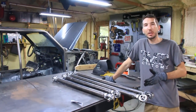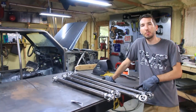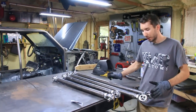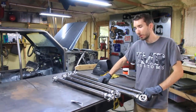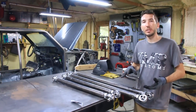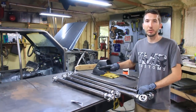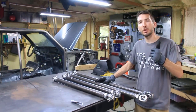Remember, if you want to make these on your own, I got these heim joints and all the materials at TMR Customs. I'm not sure if they sell link material, but you can get that at your local metal supply — this stuff is heavy so it would probably be expensive to ship. They also make aluminum links; if you did aluminum links you wouldn't have to have the bung. My question for you in the comments: would it be better to have lighter aluminum links which raise your center of gravity, or heavier steel links that lower your center of gravity? Hit the thumbs up, subscribe, and we'll see you next time. Thanks a lot.